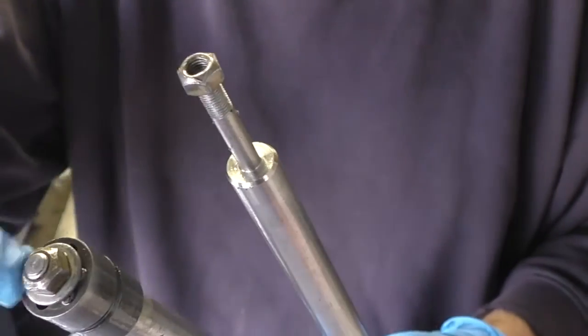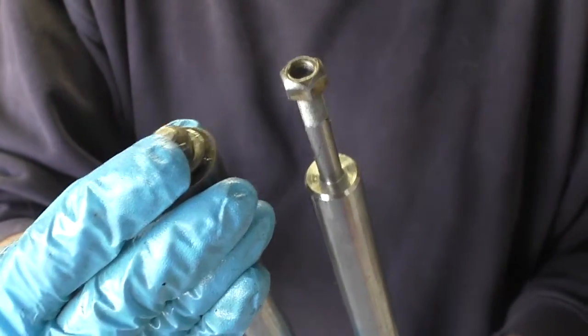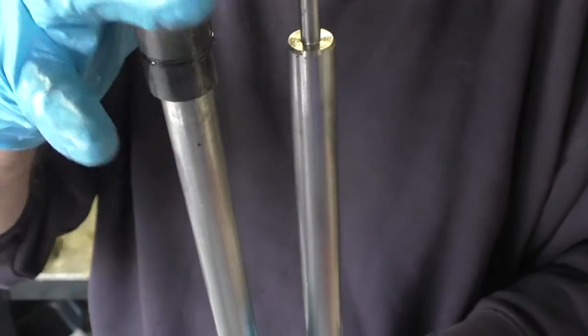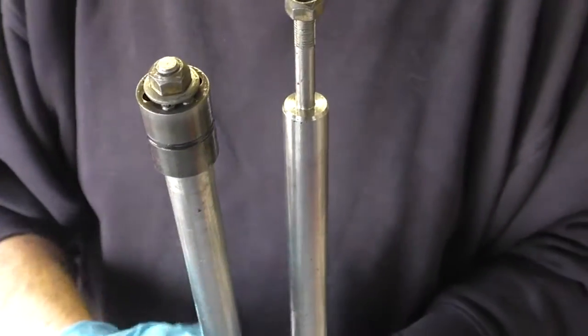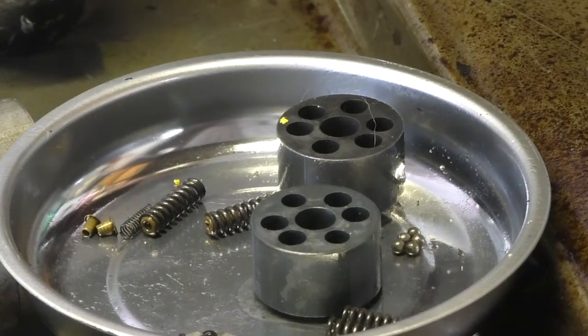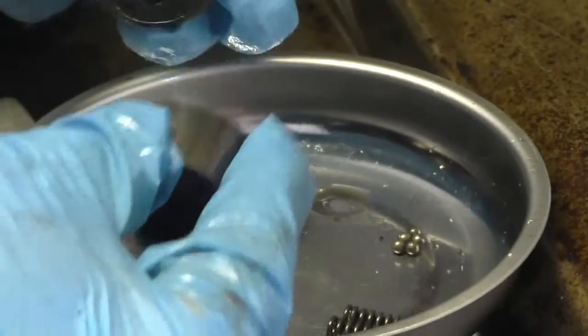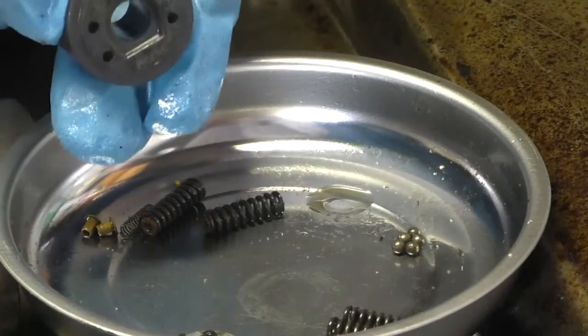When you take off this nut or pull out a bolt, either way, take the whole piston, be very careful. If you want to put it in a vise, that would be great. Make sure it's vertical when you do it. And you undo the bolt and you pull it up very carefully. And what you wind up with is this piston assembly complete. So when you pull that sucker apart, it's got two halves, and the two halves are mated together, and there's only one way they can go together. There's two halves, and there's an emboss on one side. I don't know if you can see that, but there's only one direction that these can go together.